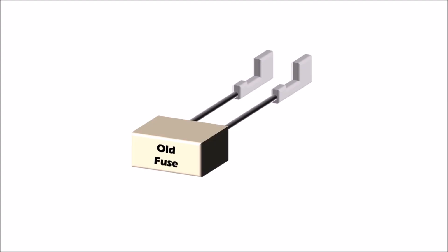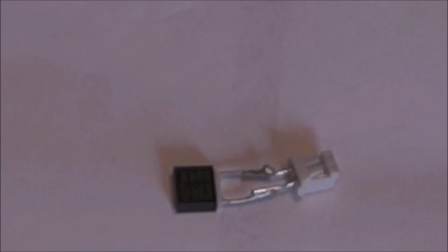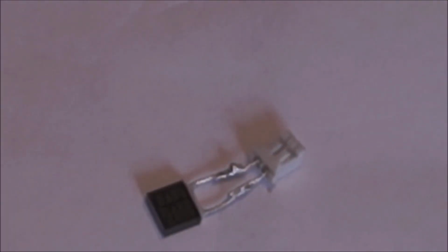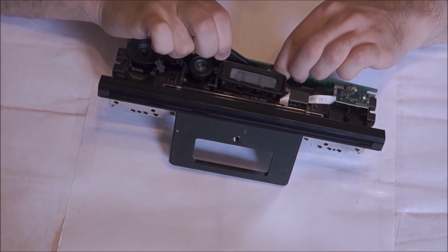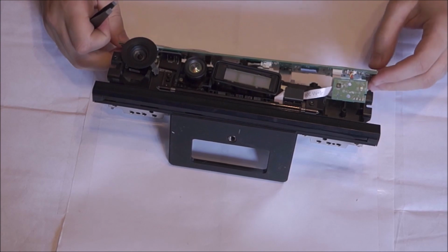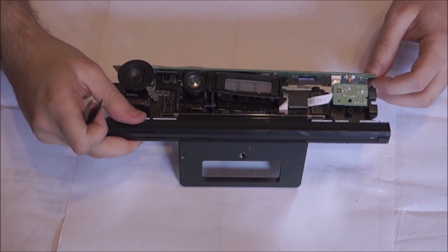So once you've done that, just replace the old fuse with the new fuse shown with this terrible animation here. Don't solder it. In this video you can see that I've soldered it, but after I connected everything up, I noticed that it still wasn't working, and what I've actually done by soldering it is I've blown this fuse as well. So don't solder it, just expose the wires and wrap them together. Wrap them quite tightly. You can use a pair of pliers to squeeze them to make sure they're tightly attached. Anyway, after that, connect the new fuse back to the actual Kinect itself. And that's it. So everything should now be working.